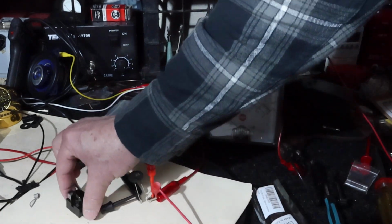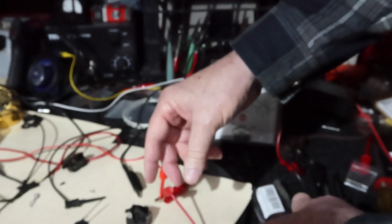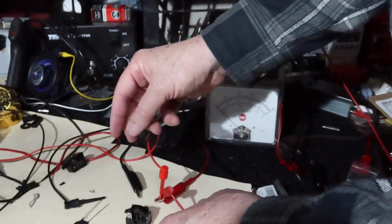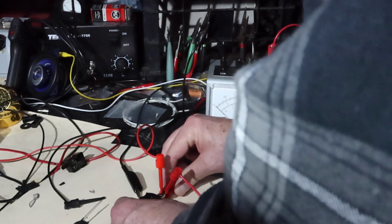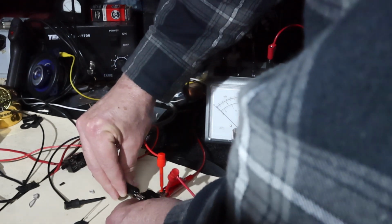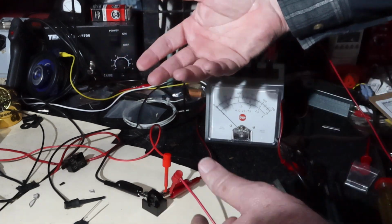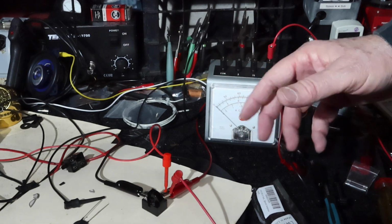Now let's look at the PTC, the positive temperature coefficient thermistor. So the purpose of this is that, that's hot, that's why I'm trying to touch it. The compressor in the cooler has a higher resistance to get started, so it needs a little extra boost. So what it does is it has the starter winding in there helping it, but then as it gets warmed up and gets going, then the starter winding drops away and it runs on just the motor winding.